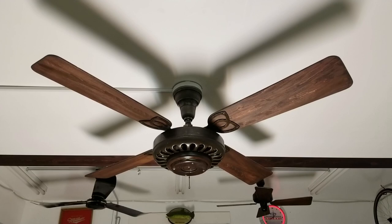Yeah, the blades turned out like night and day compared to how they were. They had splatter from paint — it was actually lead-based paint, so I had to get a respirator and get some negative air in here. I just kind of buffed off all the paint and ended up leaving all the original patina behind, which is really nice. There are a couple spots that are a little buffed out more than they should have been, but it had thicker paint areas, so there wasn't much I could do.